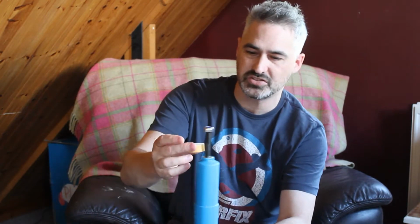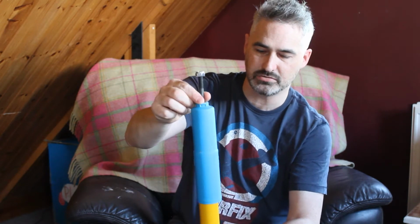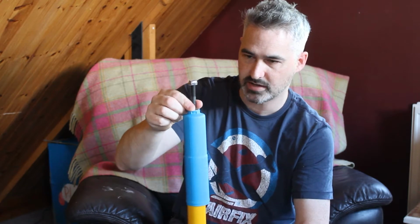Now, every so often my XJ-S makes a little bit of a clunk as it goes across a bump. And this is quite a common thing with Jaguars, but they have these little rubber bush donuts. They're more like a dense foam actually, but one of these sits in between cup washers either side of the top of the shock tower, and they get a bit squashed and it's not bolted straight, so you know the damper still damps and everything works right, but every now and again if you go over a bump just right, it just makes the top of the damper rattle in the wing and it gives you a bit of a knock. So I was going to buy these separately, but we've splashed out, treated the car to a complete new set of Bilstein B6 dampers, and I can't wait to get them fitted.